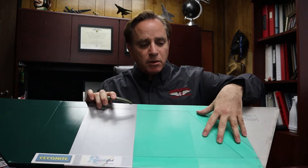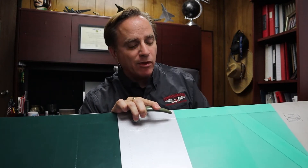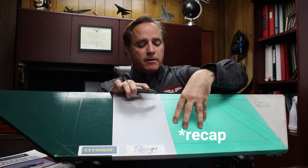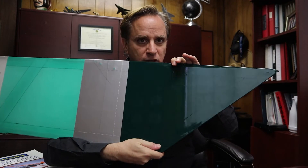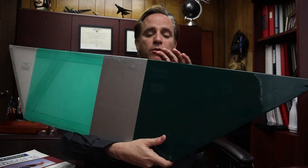When putting on tapes, the first brush coat is critical because all subsequent coats adhere to that first brushed-on coat, which reaches its little tentacles through to the back side of the fabric and encapsulates it. Everything else sticks to that very first coat, but you only brush it on once — any more than that and you'll end up with brush marks in reflected light later when you're all done through color. Nitrate, butyrate clear or tan, silver, and then color dope. You also have the option of putting on a polyurethane — highly glossy, a wet look, chemical resistant material, a little more resilient than dope.